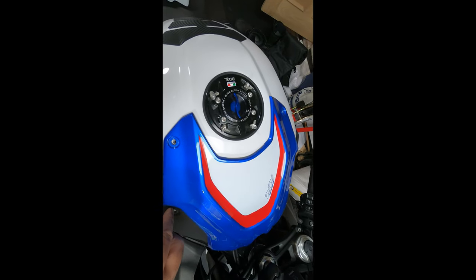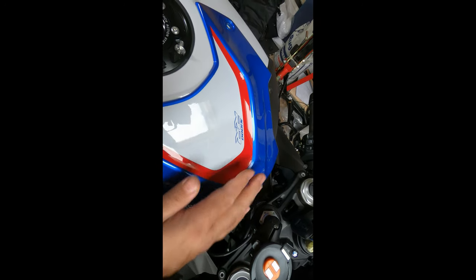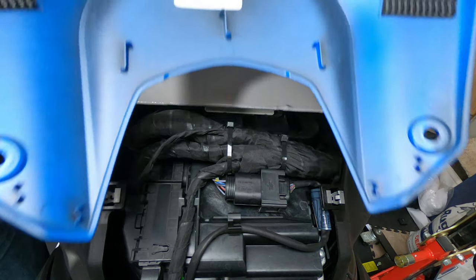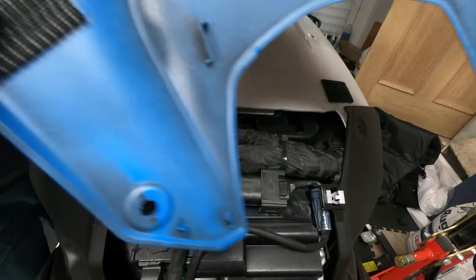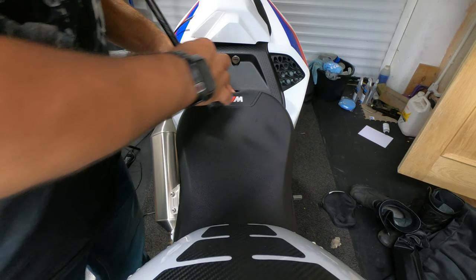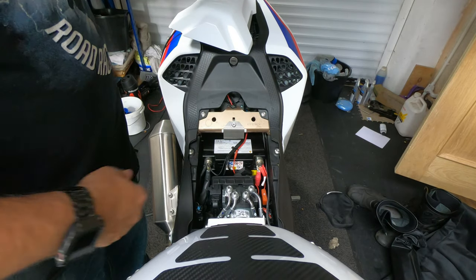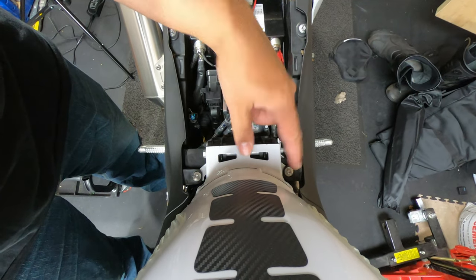I've taken these four out that you can see on the top. I've just laid them out so I know which bolt is which. The last one is this one down here, which is a bit longer, needs to come out and then this top cover will come off. As you can see underneath, there are small little clips, one at each side, and these two just slide out of the front ones. There's also some sticky back Velcro holding it on. On the M Sport, there's one bolt and it's tucked just down here. Pull the seat forward a bit with your finger and then stick your screwdriver in. Once the bolt's loose, you just pull the seat out.